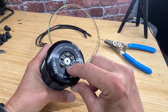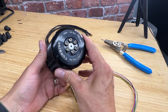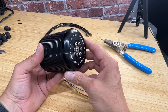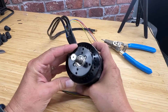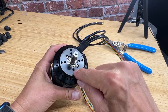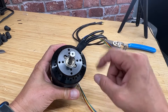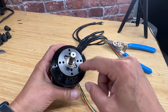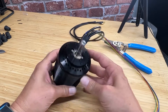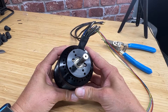On the back here you'll see the six stainless steel high-strength screws that attach this end rotor to the shaft on the inside. At the front you'll see the mounting points. The inner ones are the LaCroix mounting points for hyper trucks, and then there's another ring — I forget what the size of the outside one is, but I'll put it on the website — another common 63mm diameter motor mounting option.